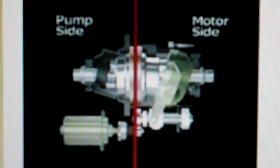A key benefit of the Hondamatic transmission is its ability to provide engine compression braking. When accelerating, the engine's crankshaft drives the clutch, which drives the hydraulic pump swashplate; hydraulic pressure from the pump drives the hydraulic motor, which rotates the output shaft, sub-transmission, and drive wheels. During compression braking, power flow is reversed — the ATV wheels drive the motor side pistons as a pump, and the pump side pistons act as a hydraulic motor driving against the engine using compression to provide braking force. The Rubicon features an ECM to provide the optimum drive ratio and optimal engine braking, using electronic sensors, a multi-mode computer map, and a control motor to adjust the angle of the motor side swashplate.